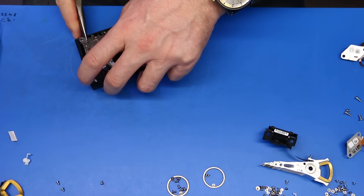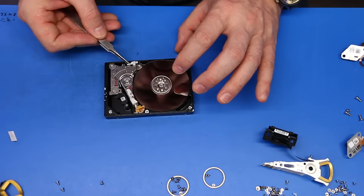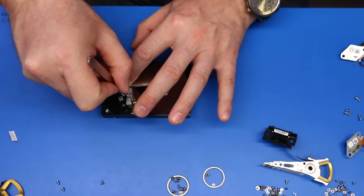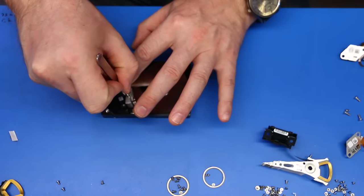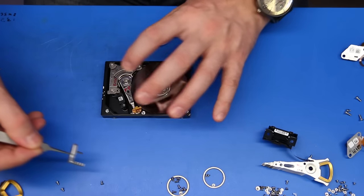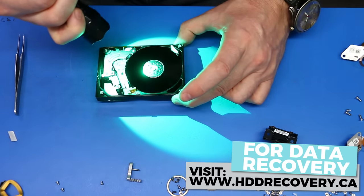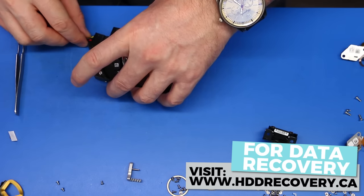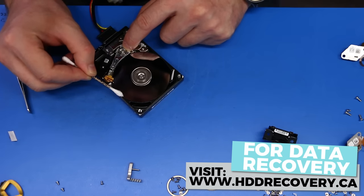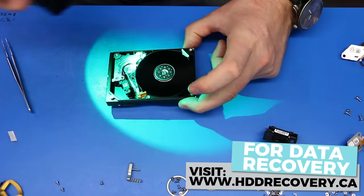In order to work on exposed hard drives, you need to create a clean room environment. The work done on drives when they're opened is always performed inside a laminar flow cabinet. The one I use is six feet wide and four feet deep, with massive HEPA filters above and three impellers that blow air inside the cabinet, purifying the surrounding air. There will still be some particles landing on the disk, since the silicone gasket lets dust in when you crack open the lid, so we ensure the top surface is clean before sealing up.